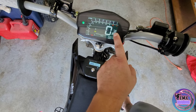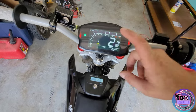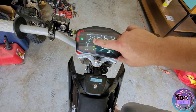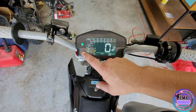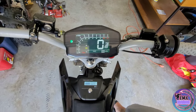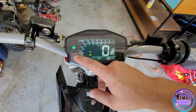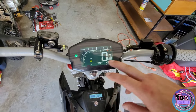Your wheel is off the ground right now — see we got speed, but it's way too high because I have it set up for my Moto Tech, so we do need to change that. As you can see the little gauge right here showing our amps — pretty cool. We do actually have reverse as well. I made a little short — you can hook up a reverse button and once you press it, it'll go from D to R. It also has blinker indicators and a bright and low beam indicator that you can hook up later on — that's kind of a separate 12-volt system.